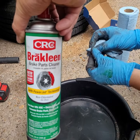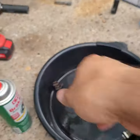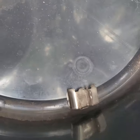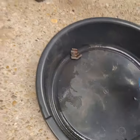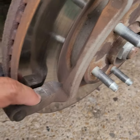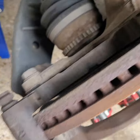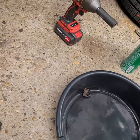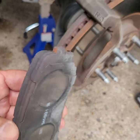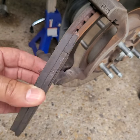Some brackets come with new ones, but it's okay — we can reuse the old ones. We're just taking everything off, then we're gonna put some brake grease everywhere metal touches metal: inside here, here, here, up here on the other side. As this slides in and out, it just keeps the dust off and prevents any noises.